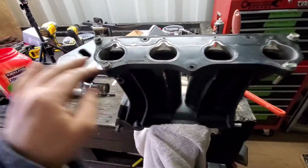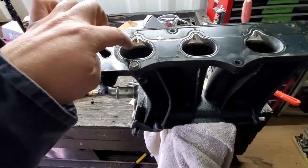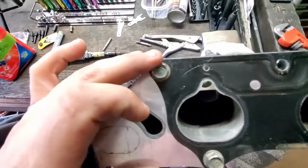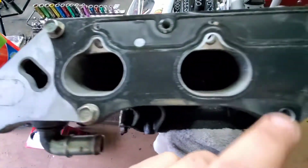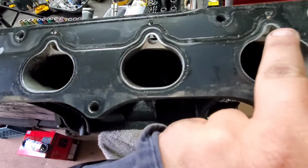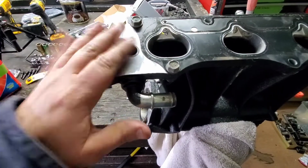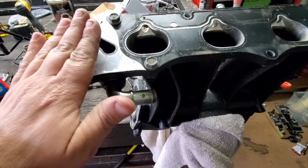That way it keeps this sturdy so that I can draw this line with a Sharpie and cut this off. And then I gotta do just a little bit of it up here. Let me look. Yeah, the bottom's not too bad. Just these little front parts right here. I gotta grind out a little bit to gasket match it, but that'll be easy. So yeah, I'm gonna go ahead and get my stuff ready and cut this, and then get the flap disc and make it nice and get that ready.